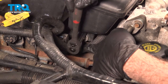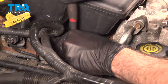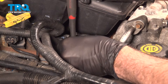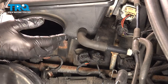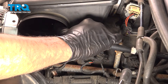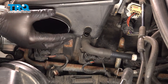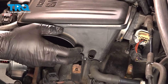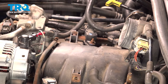Here's the other one over here. Once we have the lower bolts out, we're going to pop this vacuum hose off the side. Lift up on the air box and gently pull towards you. When you're separating the rubber O-ring from the throttle body, go ahead and set this aside.